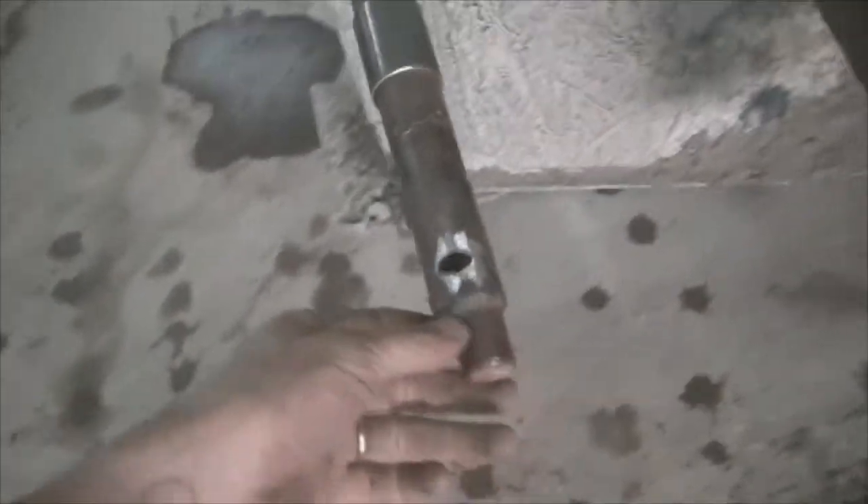Back from mudding - it's the next day now and I'm fixing this trailer. I don't know if you guys have seen me jacking this trailer up, but this thing is loose. When I got the end on it I'm cranking and almost busting my knuckles. So I figured I'd take it apart - I hammered it back straight, it was mushroomed bad. Then I welded both sides of it up. You can see how much it was wearing - there's a huge gap there, so this thing was just spinning like crazy.